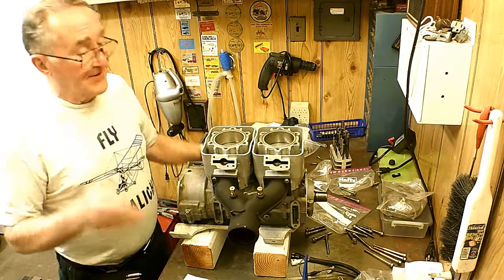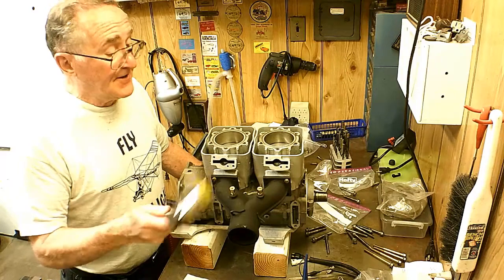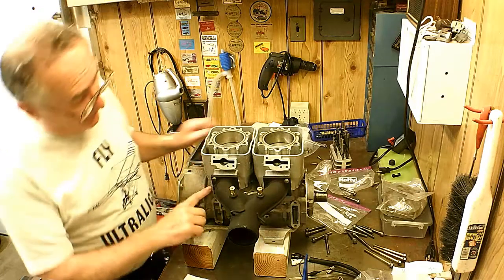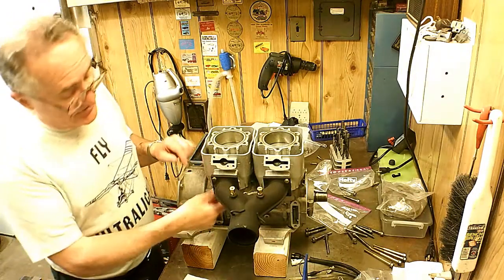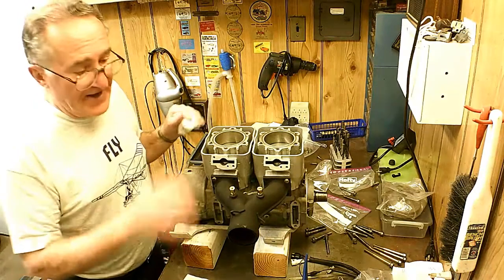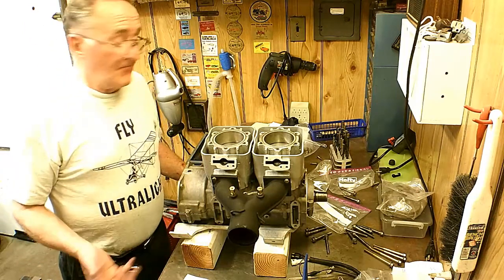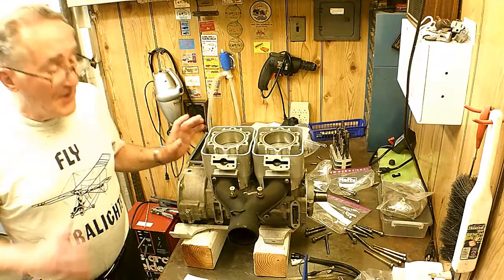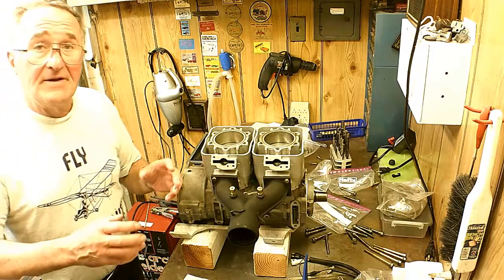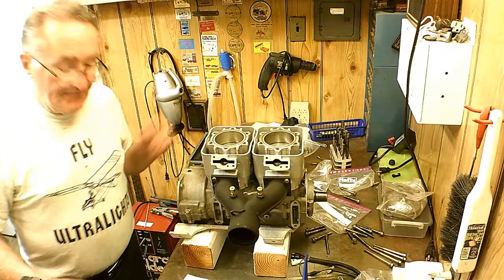If you've got any mechanical skill at all, you should be able to do it yourself from watching videos. Make sure you only use plastic or rubber hammers — don't ever use a metal hammer. And don't pry between things, don't get between these case halves and pry with screwdrivers, because then that has to be machined and flattened out. You can't get in much trouble as long as you know how to treat the metal parts. And if you drop something like a piston, you've got to examine it — if it's bunged up, you've got to get a file and some emery cloth and smooth that down, because if there's any kind of a bung on there, that's where it's going to seize up.